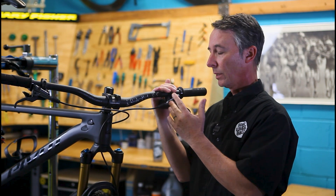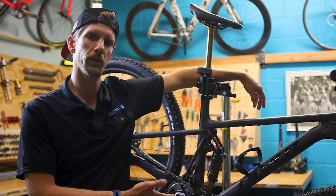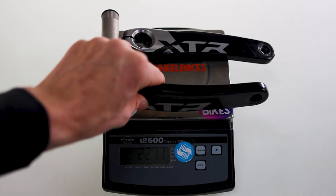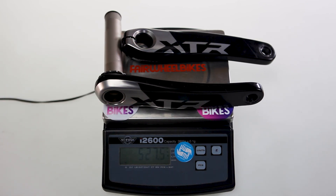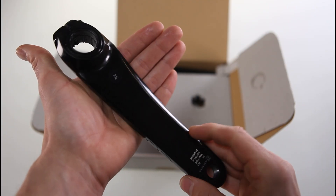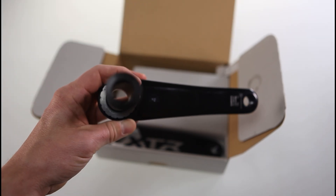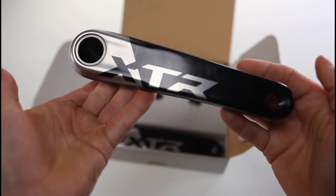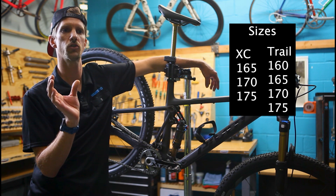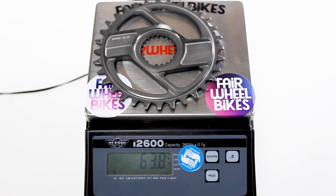You can get that servo wave action — personally, that's what I'm looking forward to, and I suspect a lot of you will too. Next, we have the XTR crank, coming in XC and trail. Shimano stuck with their hollow forge technology and 24-millimeter spindles. The trail crank and XC crank are virtually the same; the difference is the trail crank has a slightly thicker spindle, heavier wall thickness, a little more durability and stiffness — about 20 grams heavier. The trail crank also comes in a wider variety of lengths, including shorter versions than the XC crank. Chainring sizes range from 28 to 38 tooth in two-tooth increments.